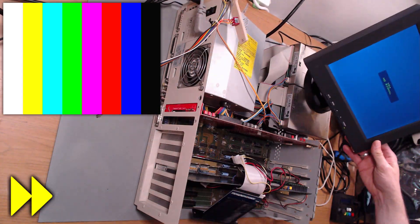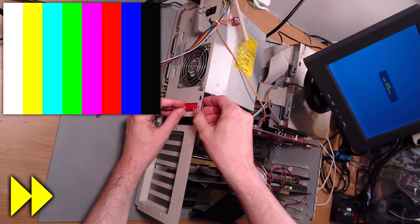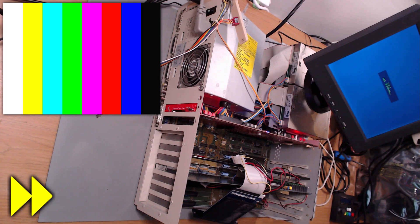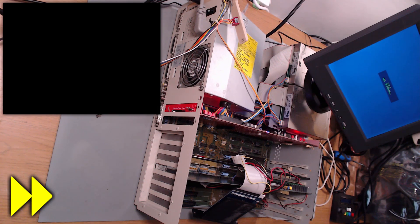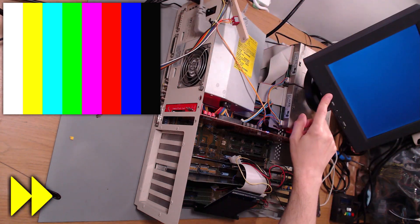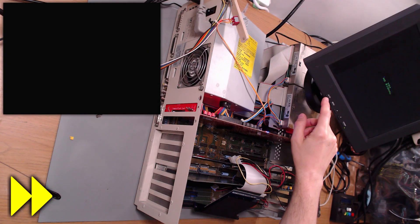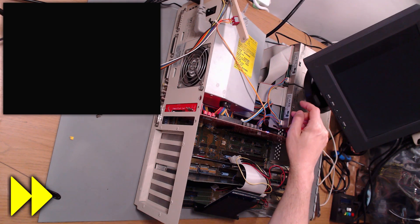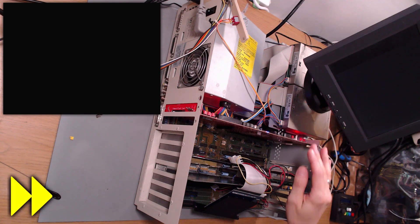So I'm going to power it off and flip the switches on the back, as I probably have this set in 68000 fallback mode. And now powering up — nothing's happened. Okay, maybe there's no drives fitted and I need to disable the auto boot option. Well that seems better — it's booting this time, so it was either that or the card wasn't quite seated properly. And it does feel like it's notably booting a lot faster.